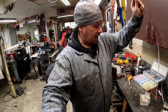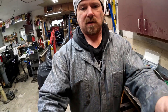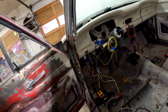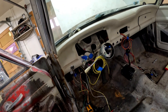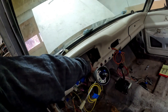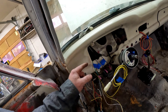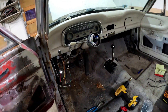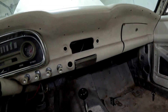I still need to spend some time figuring out how the heat system works. I found the factory choke cable and I'm hoping it's long enough. I went ahead and wrapped up the engine bay, got the brake switch done, and I still have a wiring mess in here - wiring takes literally multiple days for me. I tried testing the wiper motor and I think it's burnt up, so I'm going to have to order one. I got the knobs all installed, figured the heat system out, got the duct work in, and got wires tidied up just in case we can get that radio working.